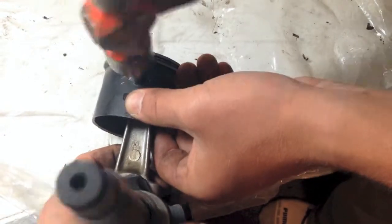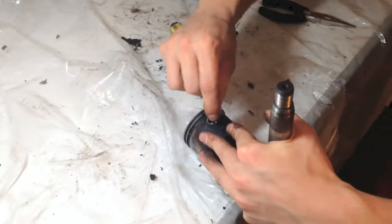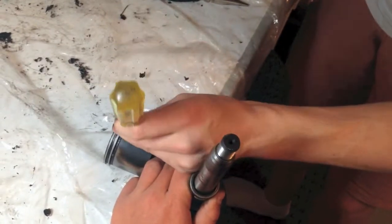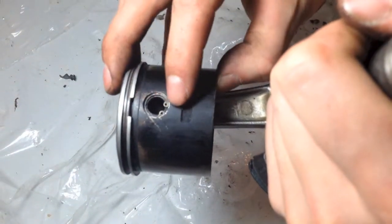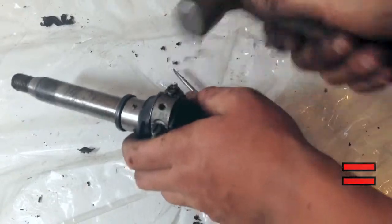After you are done disassembling your engine and changing parts, you must put the engine back together. We will put the piston pin back in and the lock rings on. The rings can be put back in by tapping them gently in with a screwdriver and hammer. To put the bolt locks back in place, simply use a hammer to hit them back up.